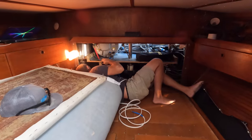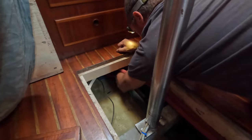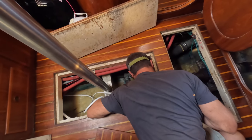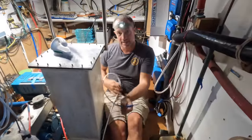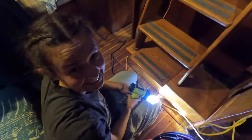We're pulling wires through for the solar panels. Bella is in the back lazarette helping. The wires are coming through the davits into the back lazarette, under the aft bed, forward through the engine bay, and up to meet the charge controllers. That covers all the rear panels back to the control room ready to hook up. We're missing one controller but have three to get started. Bella's a contortionist back there — night shift has started.